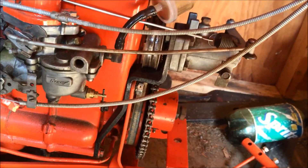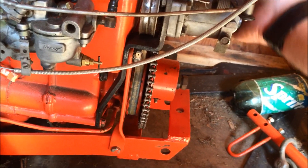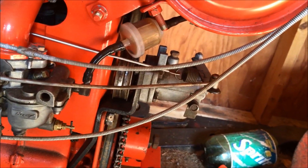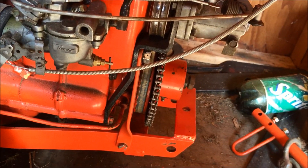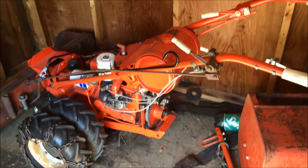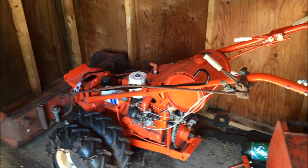I don't really like to run it that much because of that, but it runs really good. I want to fix it and I've got some of those shims in my garage - just a matter of popping the starter clutch off, getting back to that oil pump, and putting a couple shims in there. You've got to take this pull start pulley off too, which sometimes sucks. But anyway, this thing has finally got a starting system and a shutoff system now - I won't have to break my shoulders trying to pull that thing to start it.